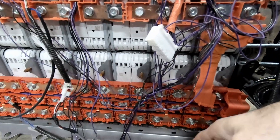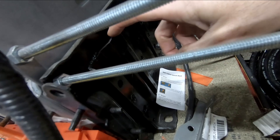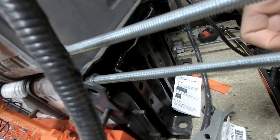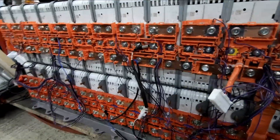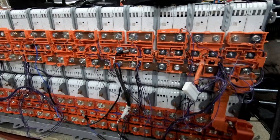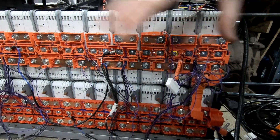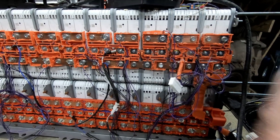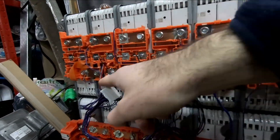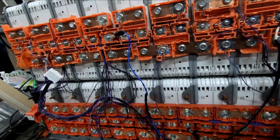There are some Leaf components we're going to be able to reuse for stress support and that sort of thing, but other bits we're going to have to remove — the plates used to hold the battery within the Leaf battery pack we won't need anymore. I need to be a bit careful about how I remove these, because these bolts and nuts are basically what holds the pack tight, and as soon as I loosen them it's going to want to expand — we obviously don't want it to expand too much or it might cause some connections to have an issue. I also need to figure out where the BMS is going to go, because that will decide how long the wires need to be. For the most part I'm not too far off — there's really only one section where wires are too short, and those can be pretty easily extended. We'll run everything probably through the channel in between the two packs to keep it nice and neat.